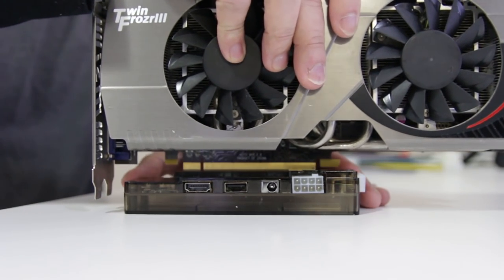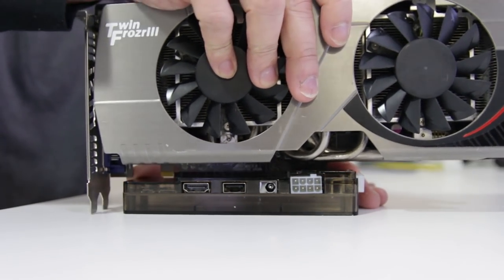Keep in mind that if you've got an MPCIe or even the M.2 slot, you're not going to be able to use all the lanes. This adapter might look like it can use 16 lanes, but in reality because it's MPCIe you can only use one lane — so it's 1x. If you've got M.2, those can use four lanes, so it's 4x. You can't get the full 16x like you would normally on your motherboard, so you are losing some bandwidth, which means you'll probably drop some frame rates.